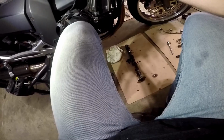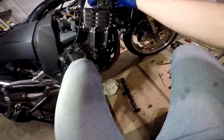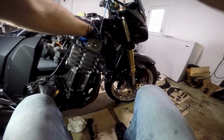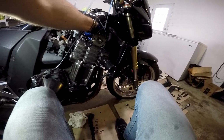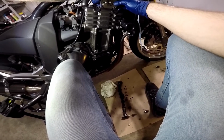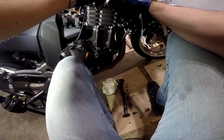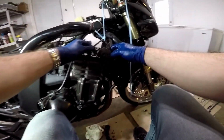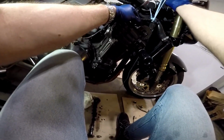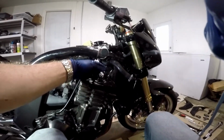Okay. I'm going to rotate the shaft, put the tooth right on the mark that it left. Now at this point, we're going to have to loosen our strap because we need the slack back in the chain. So we're going to loosen our strap here. Put that back on. Maneuver this over to its slot right there. Now we've got a hold of the chain with one hand, so we can just pull this strap the rest of the way off. We don't need it anymore. See how that was easy with a slip knot?